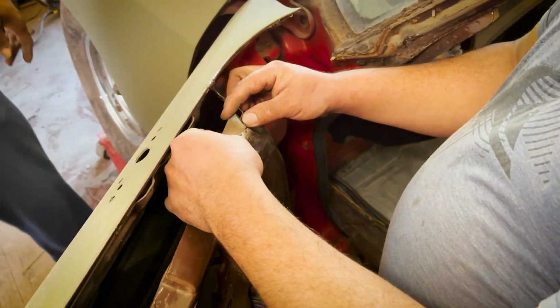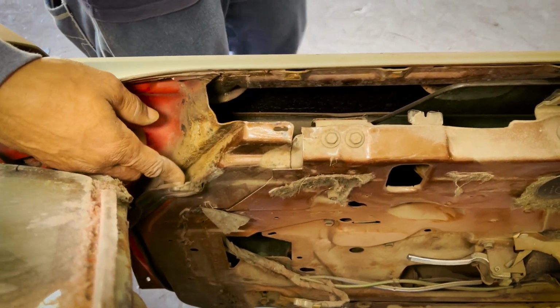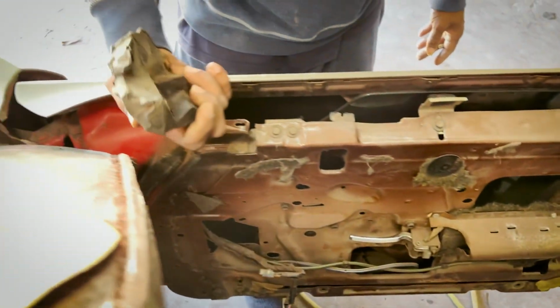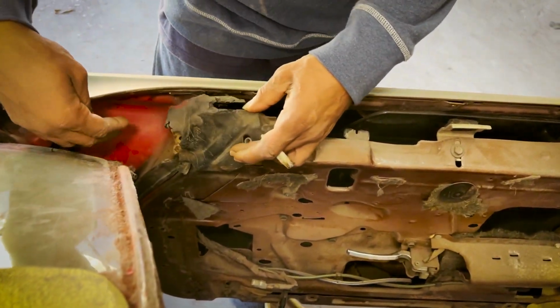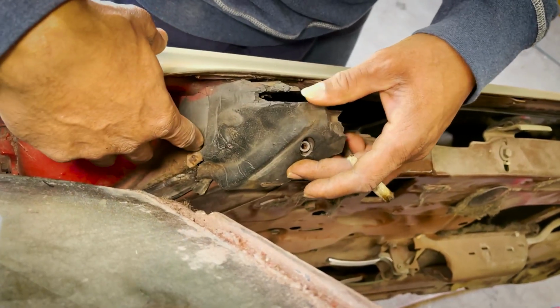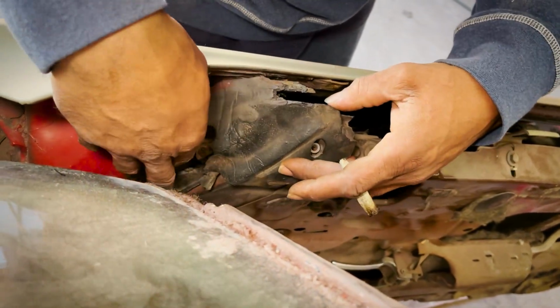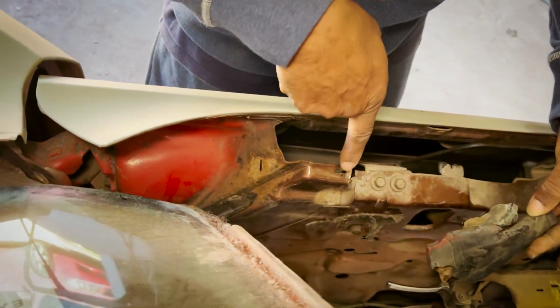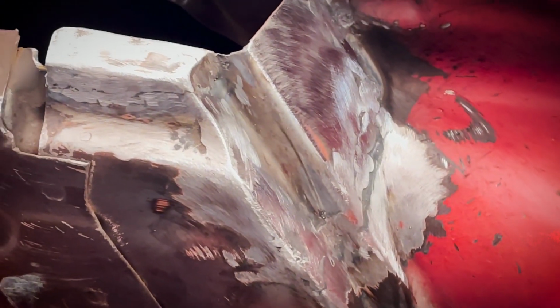And that holds the weather stripping channel that connects to this broke off piece. So once we replace this, it's a piece that goes through here that clips in. Another one here, you see another clip there? Both of those will be added once we get the new weather strip, and this is all one door weather strip. And once we replace this, we'll put the punch on that side to match this. But that's what this area is that's rotted off that.